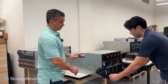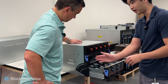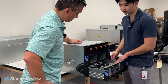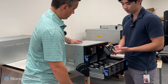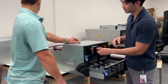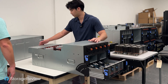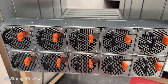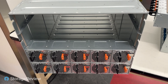Let's keep taking it apart. Right here we've got a lock that indicates it's still cabled — you can add your PCIe adapters and push it back in. You can also see all the switches and slots. Up front you've got modular fans — these are all hot swappable. There are actually 15 fans total: five here only for the compute complex, and 10 fans over here for the switch card adapters and GPU complex.